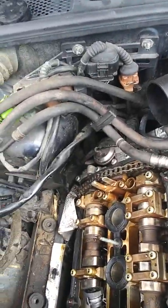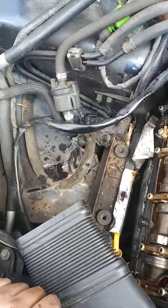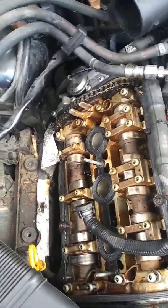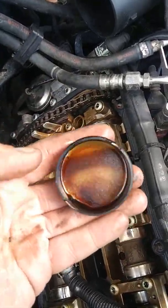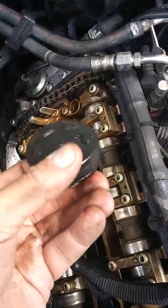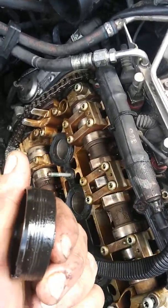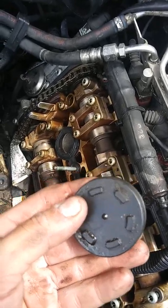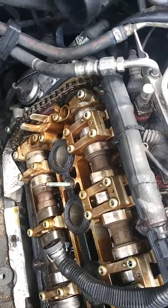I did a lot of work trying to figure it out. I was really concerned it was the rear main seal, but it wasn't actually outputting enough oil for it to be that. So what I determined it was, was these caps here. There are a couple of good videos about them, but I really don't like how those guys are replacing them. There's a much better way to do it that actually seats them properly — you're not just pressing them in, and they're going to get the right torque specs and all that.